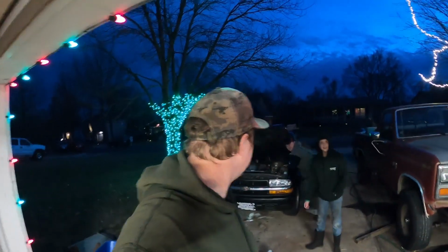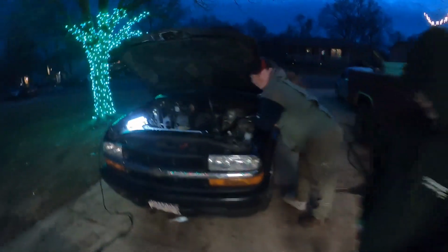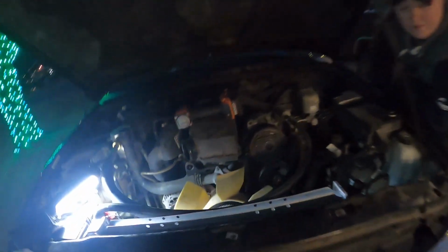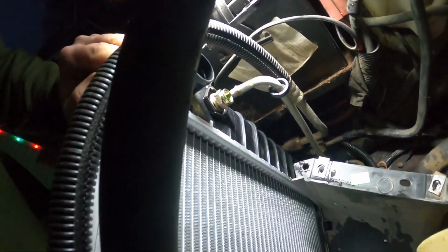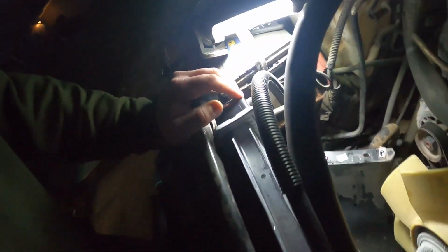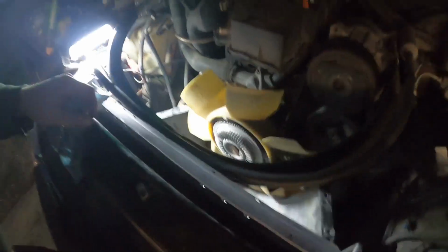Hi! I'm halfway through this project, but somebody said we should videotape whatever. Today, we're replacing Bridget's radiator. Why? Because it was leaking. We pulled the old one already. It's over there on the ground. Bad radiator. We just popped this one in here and I'm getting ready to start hooking everything back up. It's pretty simple. It just has the transmission cooler lines, and these are a push fit connection. I'm gonna put a little oil on them to lubricate the O-ring. And then the top hose and the bottom hose is down there. And that's about it. And the shroud holds everything else in.